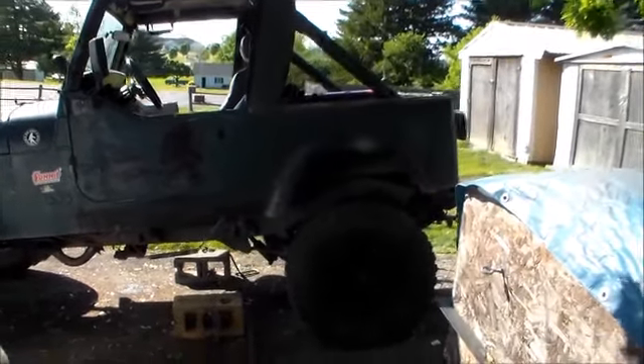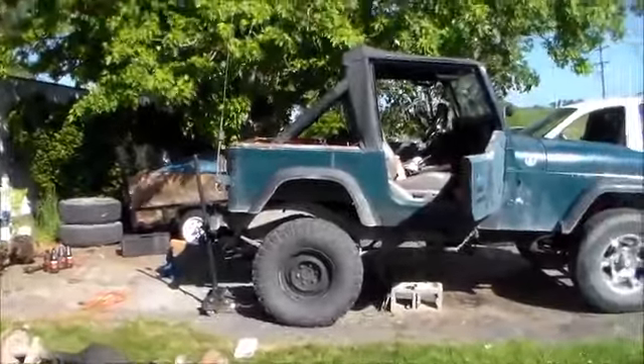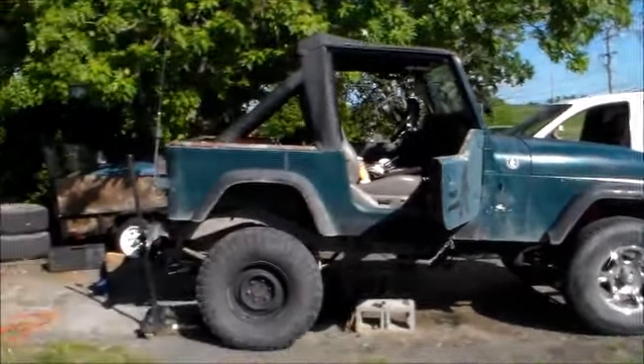I should be finished. I'm just going to switch the rear ends today. I got my axles on. I got the tires. All I got is just the axles hooked up — I ain't got the brake lines hooked up or the emergency brake cable hooked up. I just now finished this part. I'm doing it by myself. That's what the Jeep looks like right now. And that's what the shocks look like. Look around the other side, you'll get a better shot. Don't look too bad. Now it kind of looks like a scooby-mobile, you know. That's how low it is now, and that's without the shocks on.